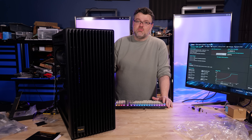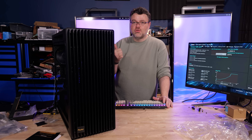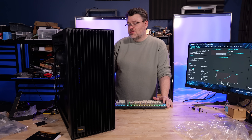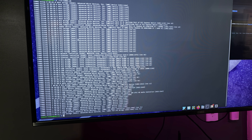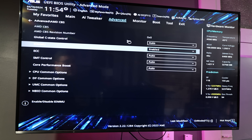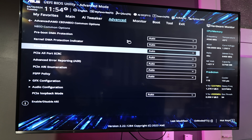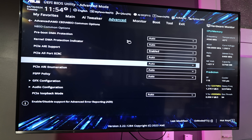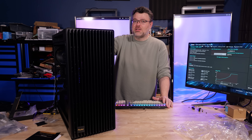In terms of Linux device support, everything on this motherboard is top-notch. This is an absolutely top-shelf Linux experience. 2.5-gig, 10-gig, wireless, onboard audio with the Realtek ALC-1220 — it's all very well supported. For IOMMU grouping, you do have two X8 PCIe Gen 5 slots all the way back to the CPU, plus a PCIe Gen 5 M.2 through the CPU, and you can do bifurcation in the BIOS for X8/X4/X4 configurations. If you want to go deeper with PCIe peripherals, you'd probably want to trade up to TRX50 or something with more native PCIe connectivity.